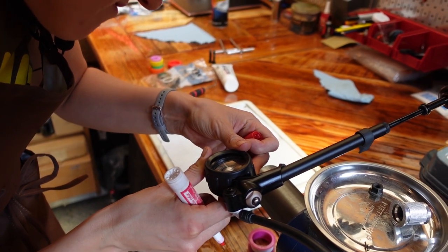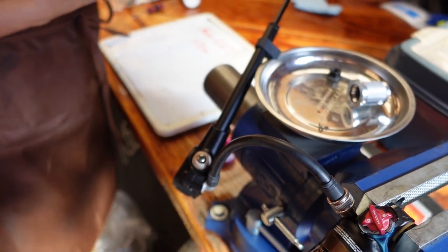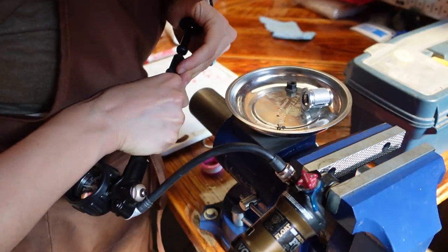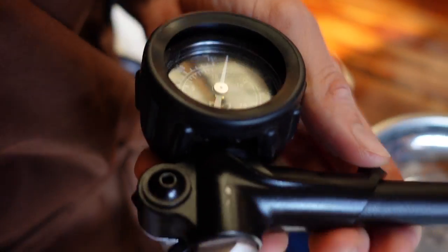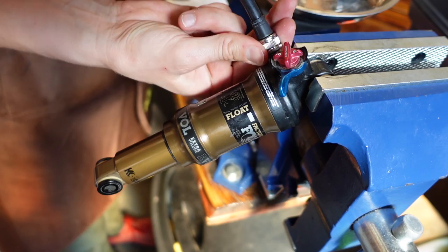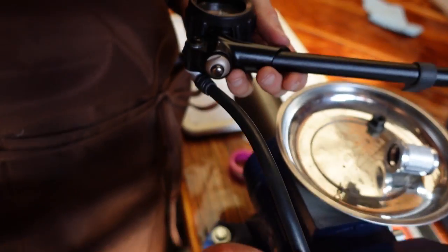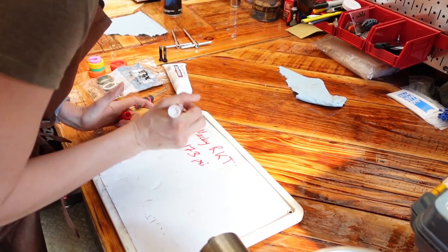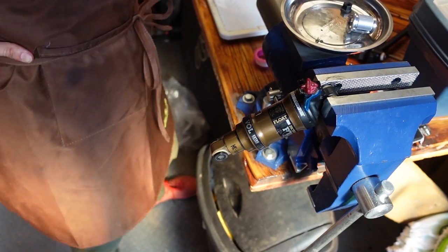They say it makes it easier to slow the rebound all the way down as you're putting it back on. It's at 154 to me. No, 158 — but that's after it has filled up the hose of the shock. So put it up to 170, disconnect it, connect it again and see how much that does. Because it's such a small volume in the can, the amount that filled up the hose took up a lot. So if it reads 170 then release it — it came back to 155, that's 15 PSI. So 158 plus 15 is your actual air pressure. Now you can release the air pressure. It always smells like dead.